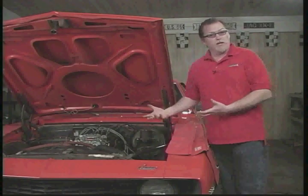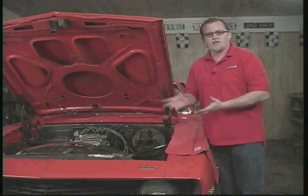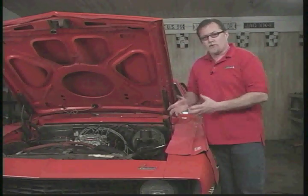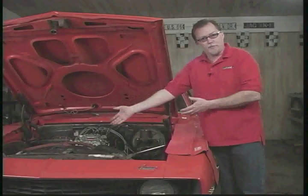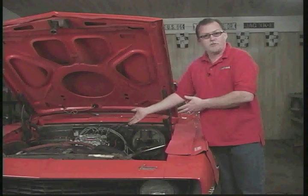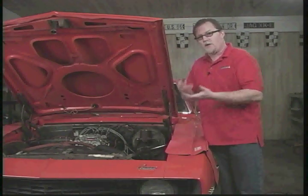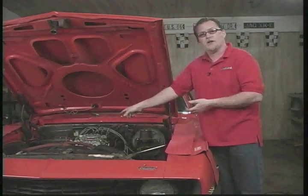Let's say the engine idles fine and runs fine just sitting here — you can rev it up with no problems. But you take it out on a road and under a load it pops and sputters, or just doesn't have the power. What that's usually indicating is a lean condition while under a load. What you need to look for is a pinched off fuel line, like maybe down at the fuel pump. Under a load going down the road, you're pulling off the main jets and flowing a lot more fuel and air. It could be dirt in one of the main jets, or even inserting a new fuel filter can shave the inside of the hose and get a little piece of rubber that goes through and plugs off a main jet.